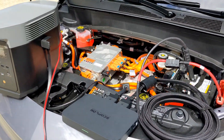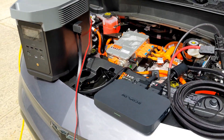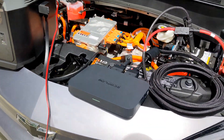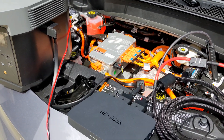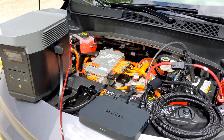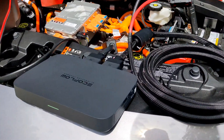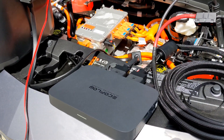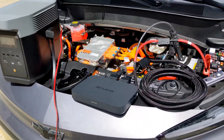People say the Pecron is so much cheaper, but with this deal they were about the same price, and on top of that this integrates with the app — I can control it remotely — whereas with the Pecron you have to manually adjust. I've also tested the minimum voltage threshold, which is set to 13 volts right now. If I turn my car off, it immediately turns off — so it only runs when the car is actively powered on. There are tricks to keep the Bolt on indefinitely, which there are plenty of videos about. Also, in the manual there's a section about using an XT60 charging mode from the alternator charger, which suggests they're planning a generic cable to go to an XT60 on other EcoFlow power stations, making this usable in a more generic fashion like the Pecron.